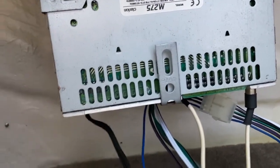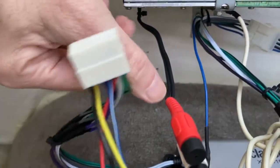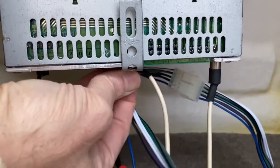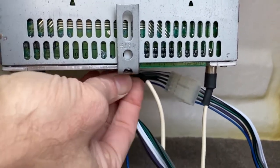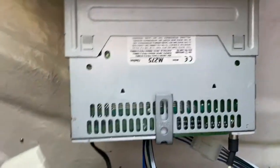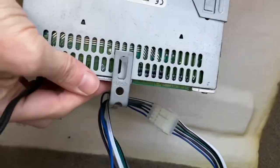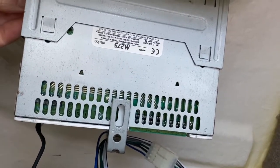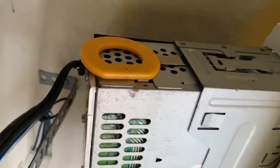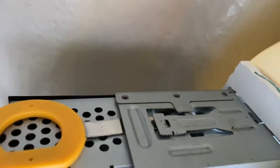I'm going to disconnect the harness from the Clarion. If you go for something like the M508, that harness will plug straight in, but I won't be doing that. I'll unscrew this little bolt holding the brace which holds the stereo up, unplug the antenna, and then give the unit a push. It's going to jam, so I'll use stereo removal tools popped in each side to pop those clips out, and then it comes right out.